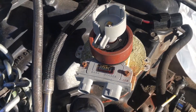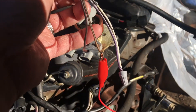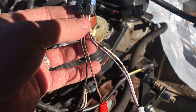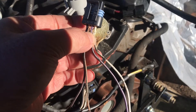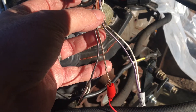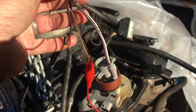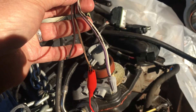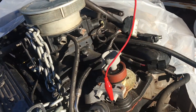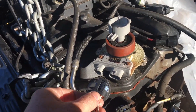You take this timing tool, which I made myself — it's an electronic fuel injection connector, the same exact connector. It has a white wire, which is your electronic spark timing; purple and white, which is reference; bypass, which is tan and black; and then the dark one is your ground. The way the timing tool works, you jumper the purple-white and the white together, and the bypass has a jumper connected to 12 volts when you're setting timing. Let's plug this in now.